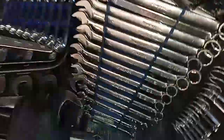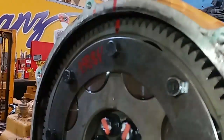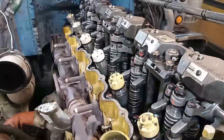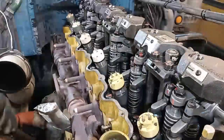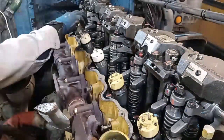I'm not going to be using any wrenches for this video. I generally like to turn the engine at the front — you can see the red line lines up with the belts. To know whether you're on cylinder one or six, I have the peanut cover off so you can see the gear mark lines up with the front structure. Number one cylinder is on the right side, and as you work back toward the left you go two, three, four, five, six.